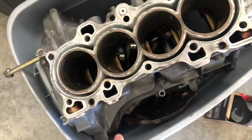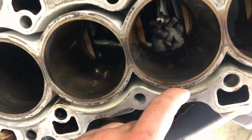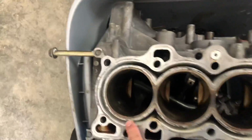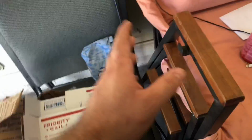And of course, we're going to be showing you the process right now. First off, we are going to start by cleaning up the water jacket, which goes around the sleeve. Since this is an open deck, this is where the water flows through. We want to make sure that this is 100% bare metal. That way we can make sure that the Devcon seals to the cylinder and to the water jacket 100%.